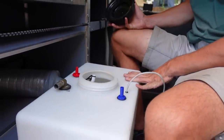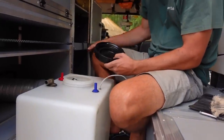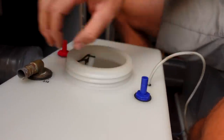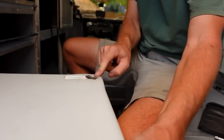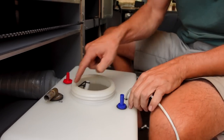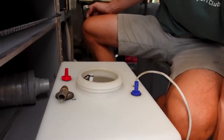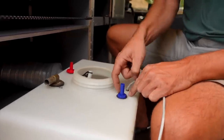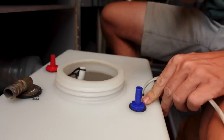We went with a 50-liter water tank that fits in one of our furniture pieces. Something really important: only put holes in the top of the water tank. Even if the tank comes with a bottom outlet, I would never use it, because if one of those connectors starts leaking at the bottom you could lose 50 liters of water into your car. At worst, a top-mounted connector might let a few drops splash out — but not more than that.